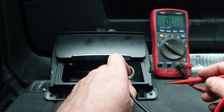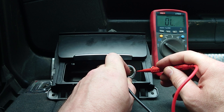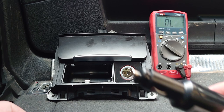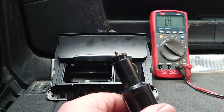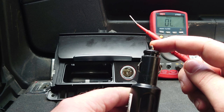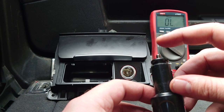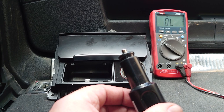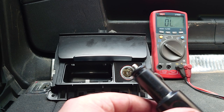Now if we touch the centre and touch the outside, we're getting OL — open circuit — we're no longer getting the beep. Also, just to explain how it works: a standard charging plug for sat-navs and such has a piece that springs out and touches the sides for the earth, and a piece at the bottom that picks up the 12-volt feed — it's spring-loaded so when it pushes in it touches the bottom, gets its 12 volts, gets its earth, and makes its circuit. Our problem was the centre piece was constantly touching the outer shell inside, causing a permanent short to earth and blowing the fuse.